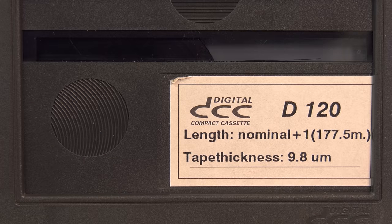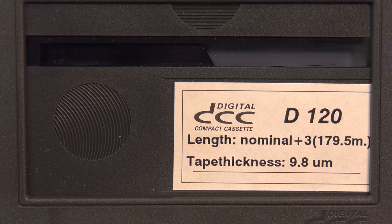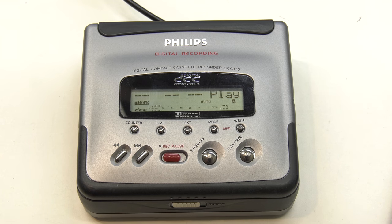All of these formats recorded successfully. The question remains: why didn't they keep the 105 and 120 on the market? We weighed the tapes — they're all about 40 to 43 grams, so it's not the weight. But the amount of tape matters; the longest has nearly 180 meters. When playing and recording that, it went fine except on the portables, which with their smaller motors and single belt had a very tough time and would even shut off. I believe that is the real reason the longer tapes went off the market.